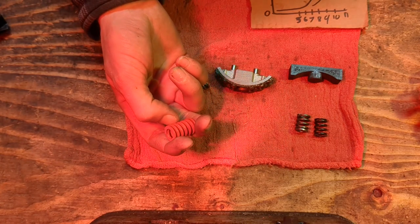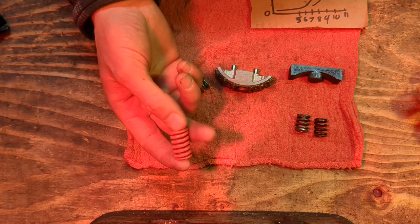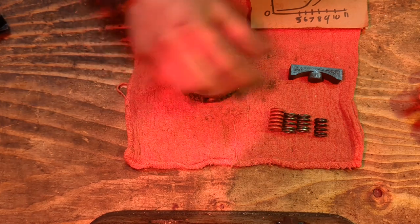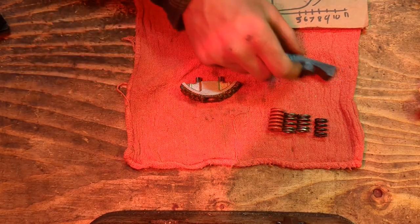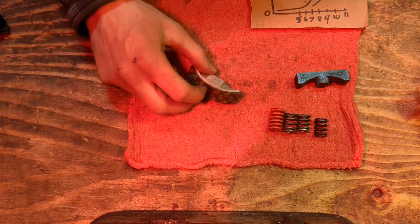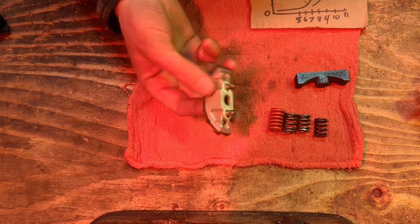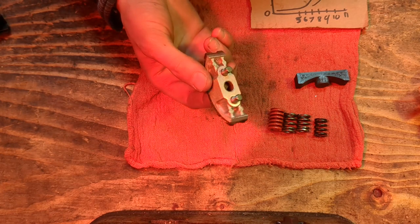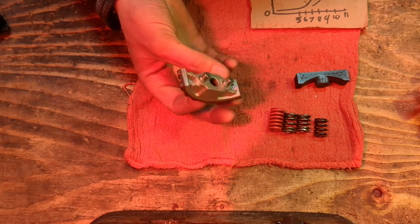You could get the stiffest spring in the world, but the gap is going to be too tiny and you're not actually going to be able to have the shoe move. But anyway, that's what you look for. I think this is a totally good option for someone racing on a budget, learning on a budget, who doesn't want to invest the $5,000+ on a new KTM 50.